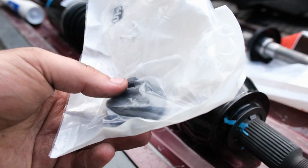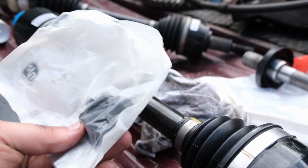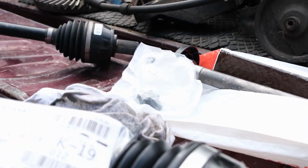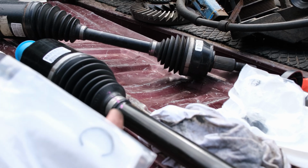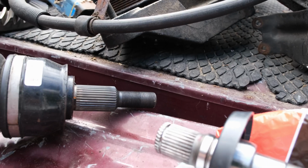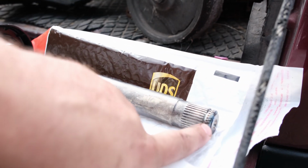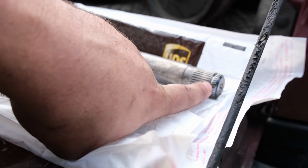Unfortunately, hopefully the wind noise isn't too much. Unfortunately, I don't have a part number on this, so I will put that in the description or the comment section. And we also need this lock ring. This goes right here on the input shaft. We'll put that on, and then I'm going to steal the one off the bad, rusted, corroded, whatever you want to call it, input shaft and put it on there.